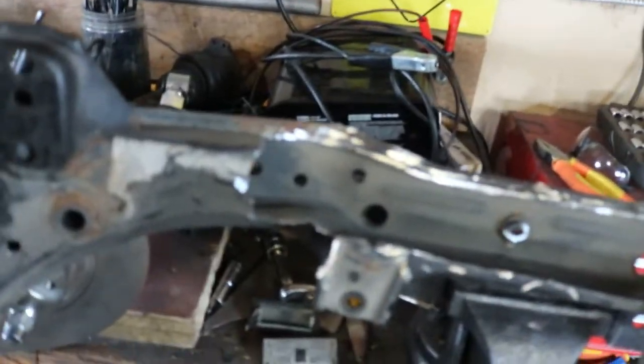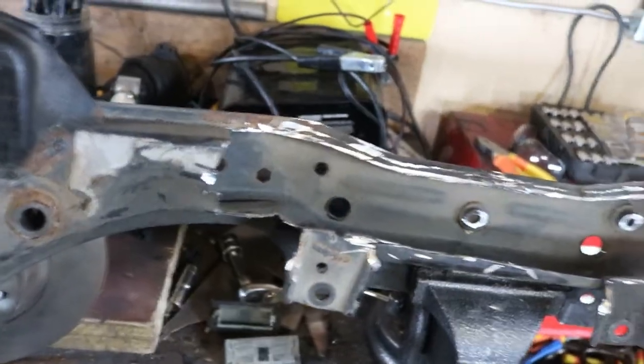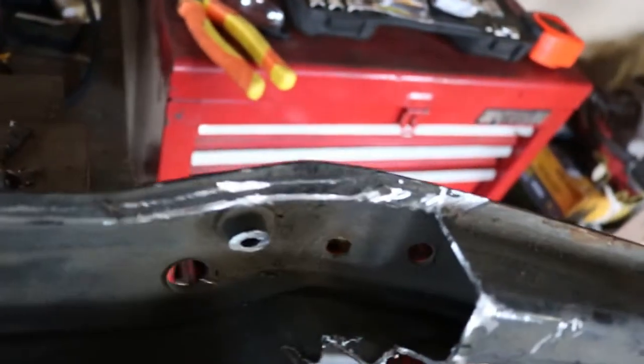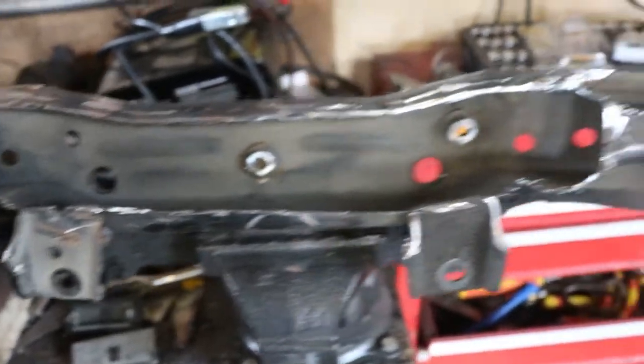In order to get clearance on here, you basically have to chop away quite a bit of the subframe. I'm going to be putting in a piece of quarter-inch two-by-two angle iron — it's not a hundred percent fitted yet but that's going in there like that, and that'll be welded in once it's in.